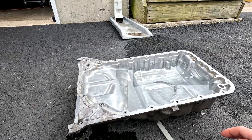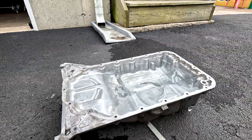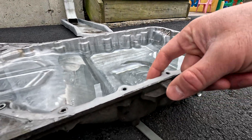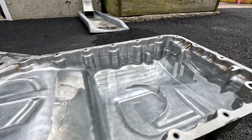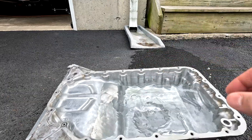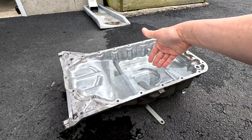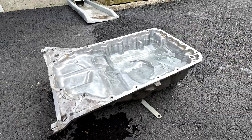Here's a perspective on how much oil — about five and a half quarts — looks like inside the S2000 oil pan off the car. The oil pan's not perfectly level and some spilled over the edge already, but it's pretty much level with the edge leaned as it sits in the car with about an inch to the top on one side. A lot of people say with this much oil in the pan, as long as you keep the oil topped up to a high level on the dipstick or slightly above, it's going to be very hard to starve the pump, being that the pickup kisses the bottom of the pan way down.